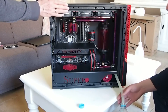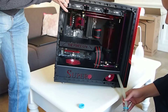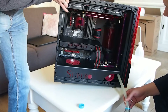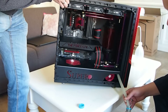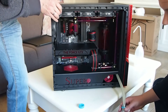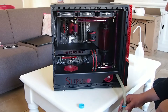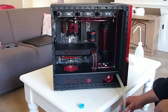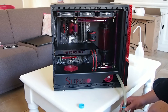We tilt it up like that and now the last bit of fluid comes out of the radiator. You can just put something under the rear side of the case and give it a few minutes and most of it comes out. After you're done, make sure you don't forget to turn the tap back to closed to avoid any drops and leftover coolant getting out — because during shipping the system will go on all sides and wobble a bit.